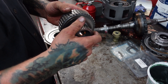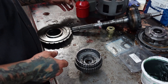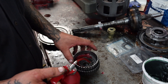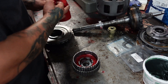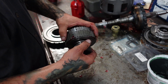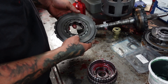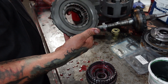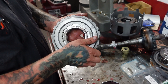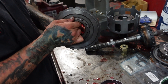It should rotate forward. Now we will oil the sprag — I'm a big fan of oiling parts whenever we're putting them together. Never want your parts to run dry, so it never hurts to take the time to oil the sprag. We've already assembled our low reverse sprag. New sprag is already in there, race has already been sanded and oiled. With this sprag installed, it should rotate clockwise and lock counter-clockwise.